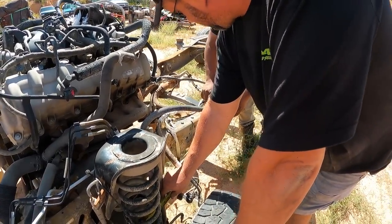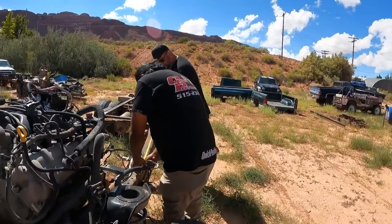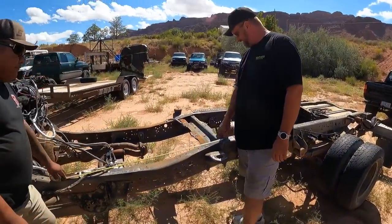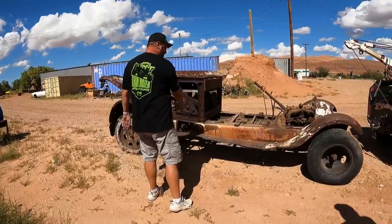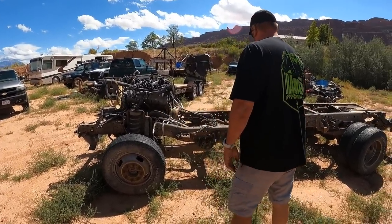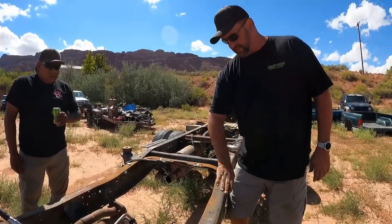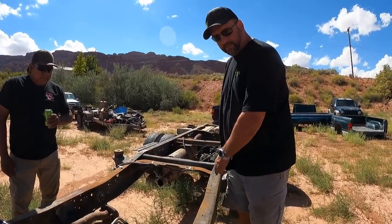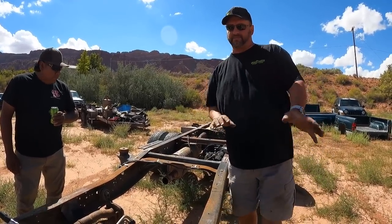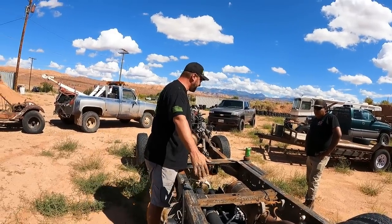About right there, yeah. Okay. 49 pound. Yeah, we're sitting right here, we'll be back to cab. Well, I see the whole running board is flat. Oh, yeah. So we may have to just make a runner that levels it out. If we use angle iron, it'd be perfect. Angle iron on here, coming in this way, and then weld it along and just make a flat all the way across. Something for the body to sit on, something for the floors, or for the running boards and everything to sit on. We do a fuel tank like right here.